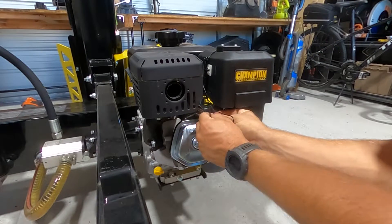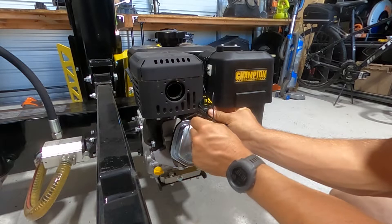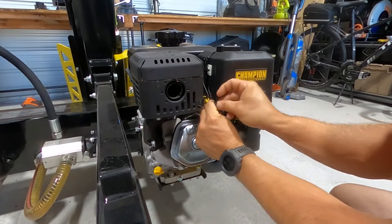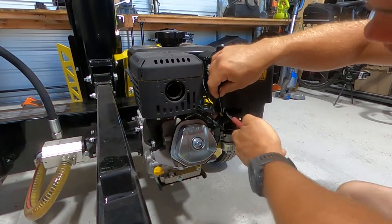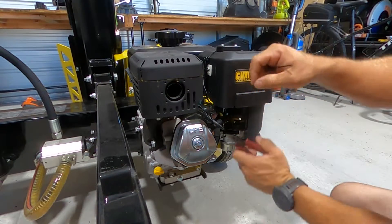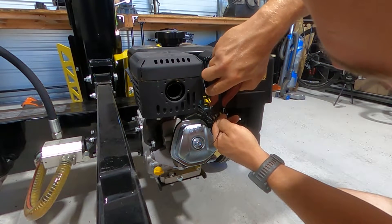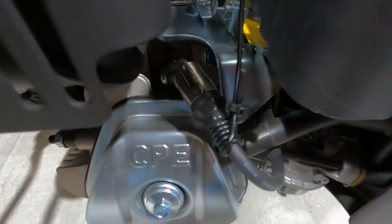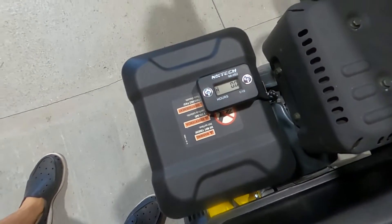We have our five wraps around the spark plug boot. I'll zip tie the excess back to this wire to make sure it doesn't come loose, then cut the excess off — leaving just a little bit extra in case it comes back through so it won't uncoil. Then I'll cut the zip tie tails off, and there we go — installed, everything finished up.